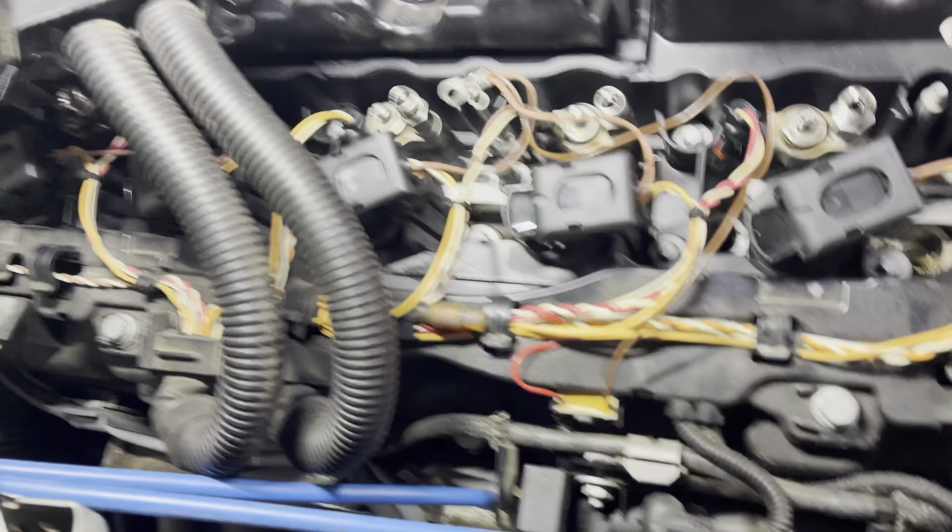I'm going to inspect everything very closely and clean everything up, then get the new gasket on and clean the surface edge for a good seal. When wiping the surface, make sure to wipe away from the engine. When you have the gasket pulled off the valve cover, inspect all areas for any cracks, following every edge closely with a light before you spray it off and clean it and get it ready for the new gasket.